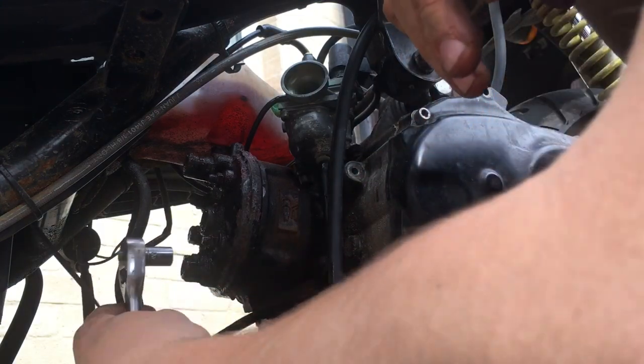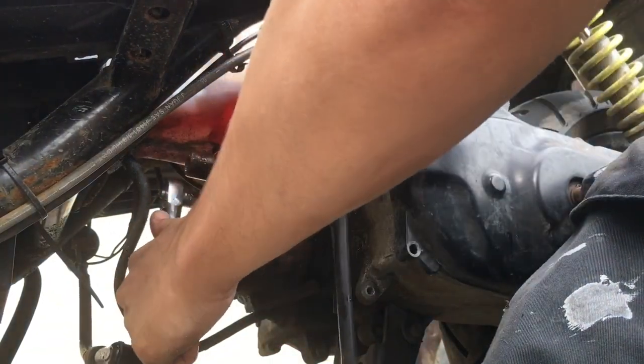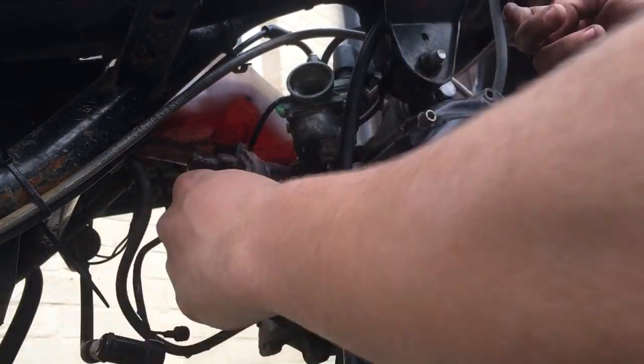Going for opposite sides — I've just done this bottom corner, now going for the top corner. One, two — going for this bottom one, three — and four. That has gone successfully, and that is why you use bolt lubricant: without it, as I said earlier, they would likely have snapped.